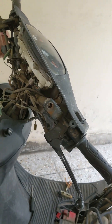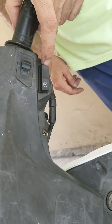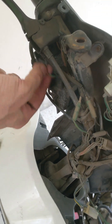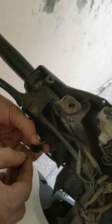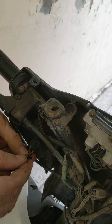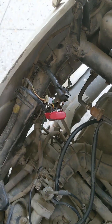Once you have ruled out the brake switch — if that is fine — then you come to the starter switch, which is here. This is the starter switch. If this is faulty, since I have already taken this whole thing out, you find the wire that connects it to the starter. Remove that wire and all you need to do is make it direct — put one end here and the other end here, and you will hear that clicking sound. That is how you can bypass this as well.